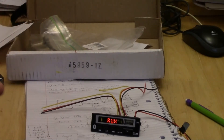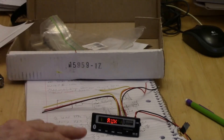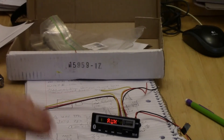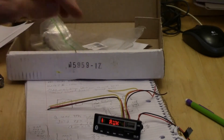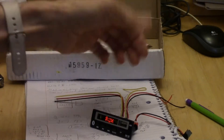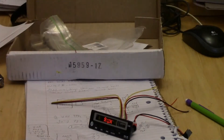I got this for my Honda Accord. I wanted to simply put it in there instead of taking the dash apart. I found that the ashtray slot is a perfect fit for it. What I would do is run a separate switch to turn off the regular speakers and switch over to new speakers, because this is only auxiliary out — there is no power amp on this. There is an auxiliary in and an auxiliary out, and that's all they have, so you'll need an amplifier to amplify the signal to get it out to your speakers if you want to do that.